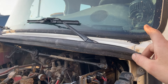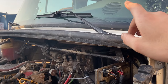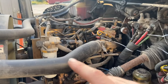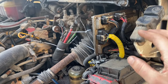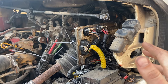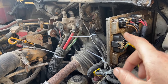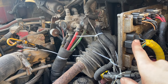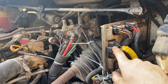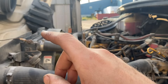So it goes from the light switch - it sends that input to the instrument control cluster, and then from there it comes out here to the bulkhead module, then to the chassis control module, and from there to the lights. It's pretty complex, but bear with me. It sends a signal to the chassis control module, and the chassis control module says okay, we want to turn the lights on. Back to the fail-safe: this bulkhead module controls the left headlight, and the chassis control module controls the right headlight.